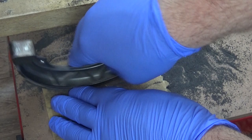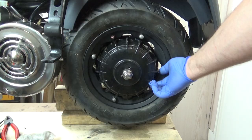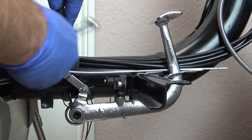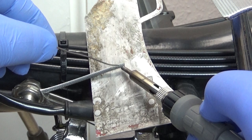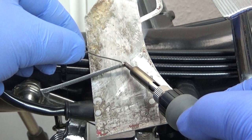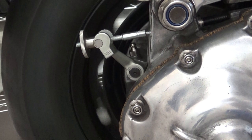After removing the wheel and getting the BGM shoes off, I found I was left with a very uneven brake shoe, courtesy of my previous attempts at fitting the rear hub, which I fixed with a flat surface and some sandpaper. With the shoes flat you can see the wheel spins nicely, which meant I could now clamp the cable into place. The inner wire is then trimmed to size and I've soldered all the ends together, which in turn meant I now had a working wheel brake. Which is handy.